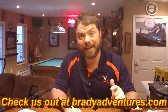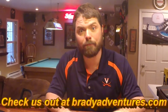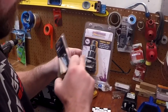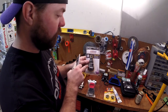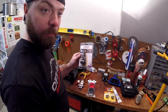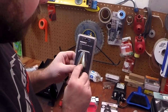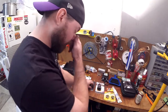Hey guys, it's Chuck from Brady Adventures, and in this episode of our dual battery install we are going to be putting our big boy pants on and punch a hole through the firewall. I just got a couple things in the mail: a Daystar firewall boot, and I'm going to run 2-gauge wires — the wires for the MLACR in-cab switch and the wires for the National Luna battery monitor — through the firewall. This is the 1.25-inch bit I ordered, which is what you need for this particular boot. The scary stuff is coming shortly.